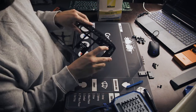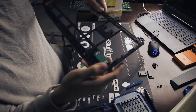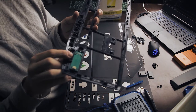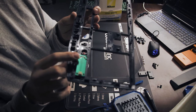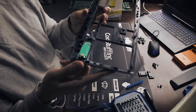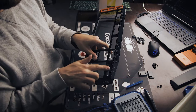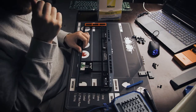The only thing I have left to deal with is this volume roller dial, which is attached to a small circuit board on the back. Unfortunately it looks like it's actually sort of plastic-riveted to the case — these small black spots are actually melted pieces of plastic that are flattened out to hold that circuit board in place. So I can't actually pull that out. I'm simply going to have to mask this roller off very carefully and then paint it, hopefully without screwing that up too badly.